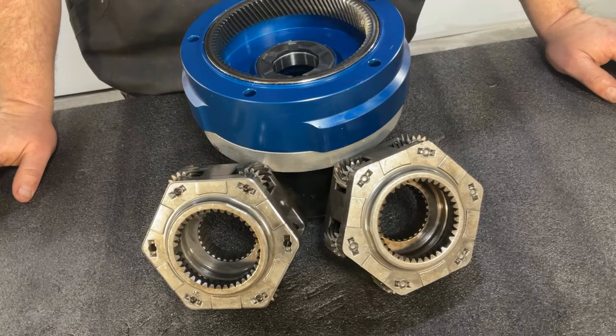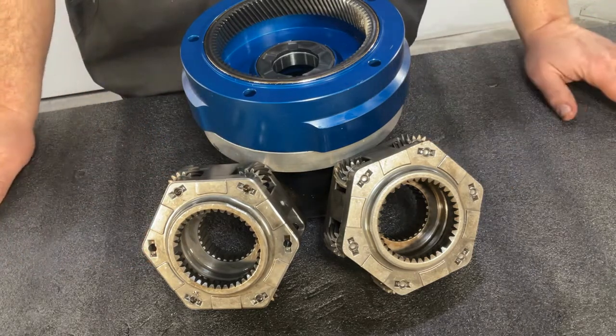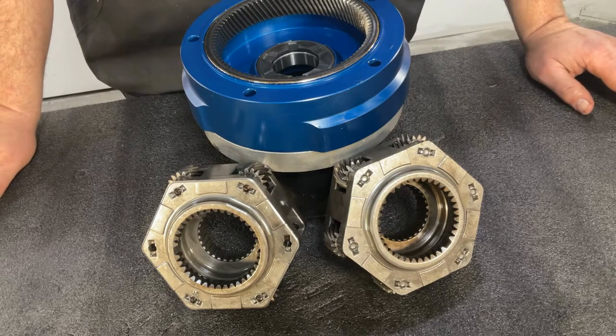As we get closer to assembling and gearing up the Strongbox, one important thing to point out is that the majority of the load is going to be carried in the rear of the Strongbox. So you want to put your strongest gears in the rear. If you're one of those people who open up your transfer case and you have a 4 and a 6 planetary option, you always want to put the strongest, the largest gear set, the 6 planetary, in the rear, as opposed to putting that 4 pinion. Most people are going to find a 6 pinion, but if you are one of the people with a 4, then if you're choosing between the 4 and the 6, put the 6 in the rear and the 4 pinion in the front.